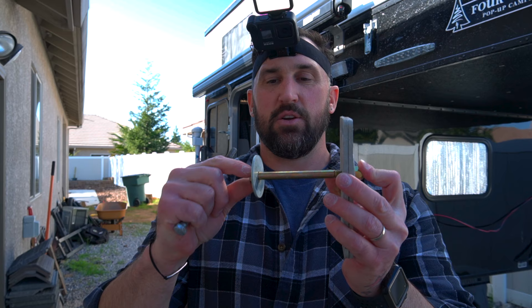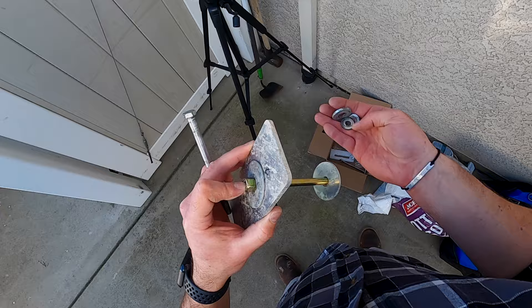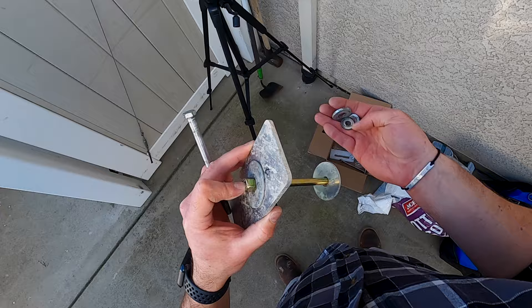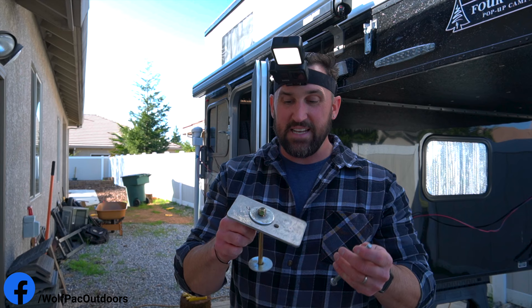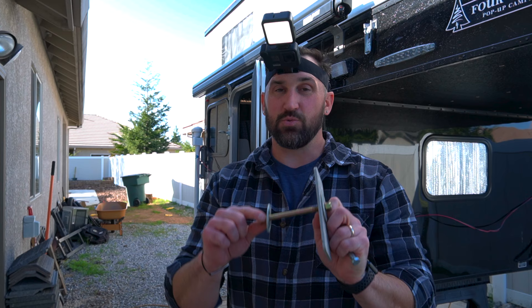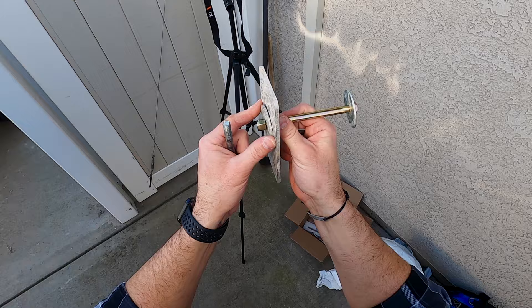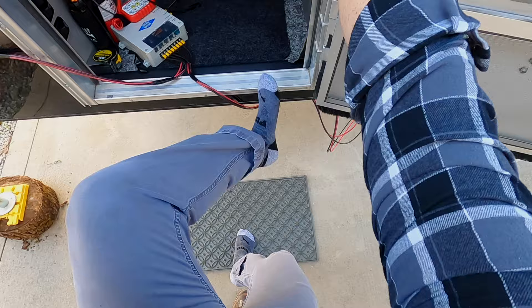The other thing we did differently with the new bolt is we got a different length. It used to be set up like this: bolt, one washer, then the camper and the tray, and then two aluminum plates. I was starting to stack washers — using like three or four smaller washers — to fill up the space, because the bolt was so long it was stopping threading and not completely tightening down to the tray. Getting a properly sized bolt gives us less washer stacking and makes it easier, since once you're under the truck it's moderately difficult to hold three things in one hand while putting the nut on. Exponentially easier — time saver, hack. Let's go.